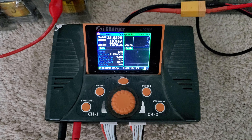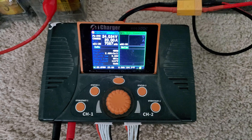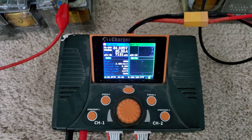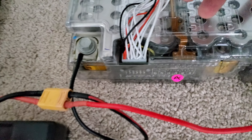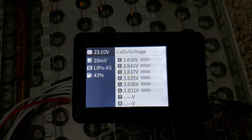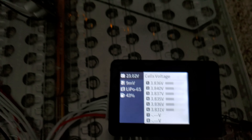We are in the lab charging a Tesla battery using another Tesla battery with a hobby charger — you can see here about 20 amps, which is what my golf cart charger puts out. These are going to replace the lead-acid batteries in my golf cart.